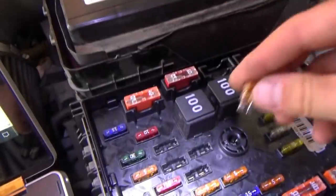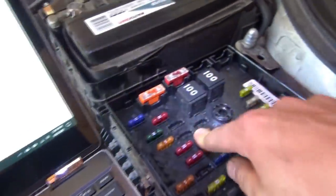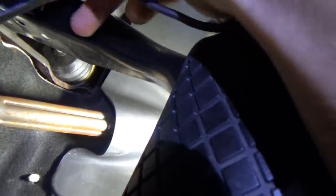It's not blown. Let's check if we restored power at our diagnostic interface. Here's our test light connected to battery ground - if it finds the power, it will turn on. Moment of truth. Yep, sure enough - we have power.